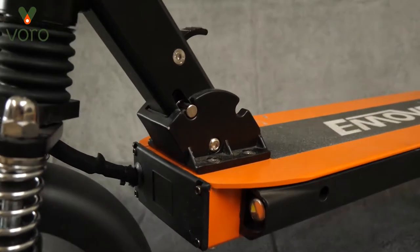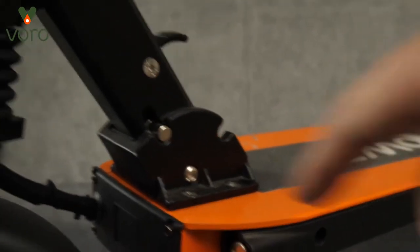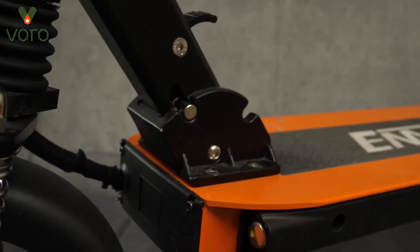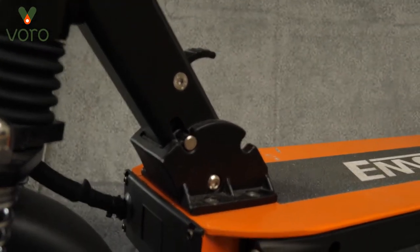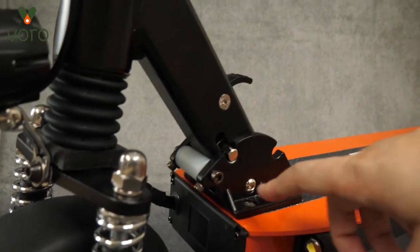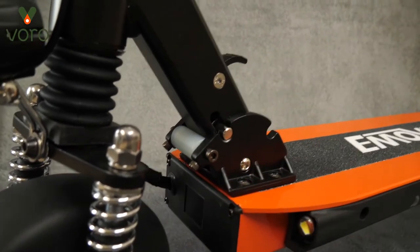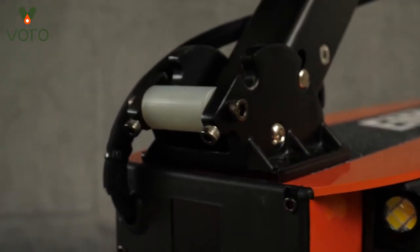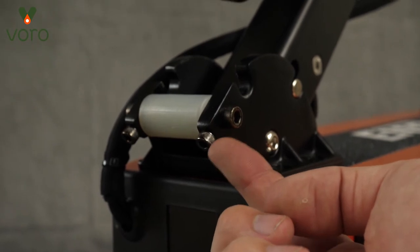Going down, you'll see that the folding mechanism on the old Touring had this solid plate in the front. While this was a totally practical solution, the issue was that sometimes you would wear away the pad, and it would lead to a lot of stem play. Our solution was to replace that steel plate with a rubber rod. The rubber rod is going to slow down how much play you have in the handlebars, because you can adjust it with these two screws down here on the bottom. This does mean that it's something that you're going to have to maintain, but it will keep your rides safer in the long run.